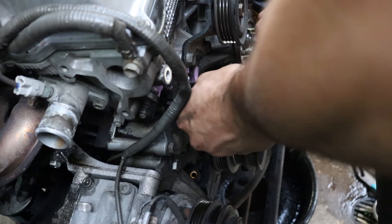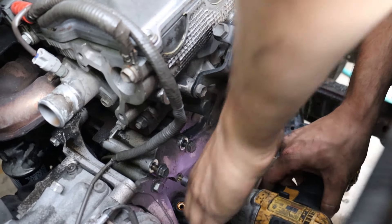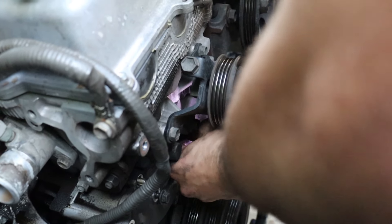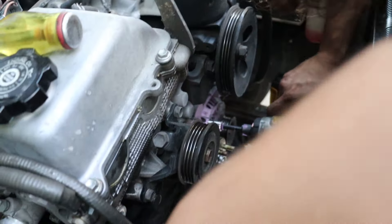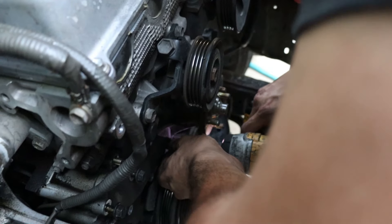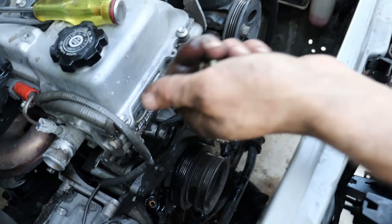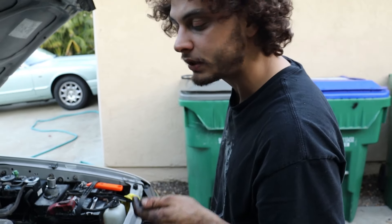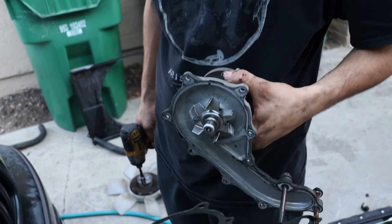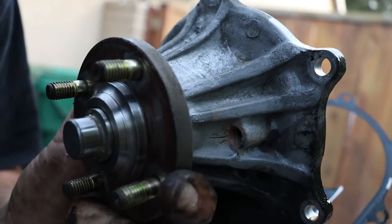Just going to zap these water pump bolts. We did 3 12s first, and then 10s — looks like the rest of it. One, two, third one, fourth one, fifth one — eighth one, ten millimeters. Good thing I had those drain pans there. So we've got about eight 10mm and two 12mm bolts and one 12mm nut to get this water pump off. And then she comes out — like that. It was probably a decent pump, but it was weeping a little bit — there's a little weep hole right there with some crusties on it, so it was maybe weeping a tiny bit. Good thing we did it.